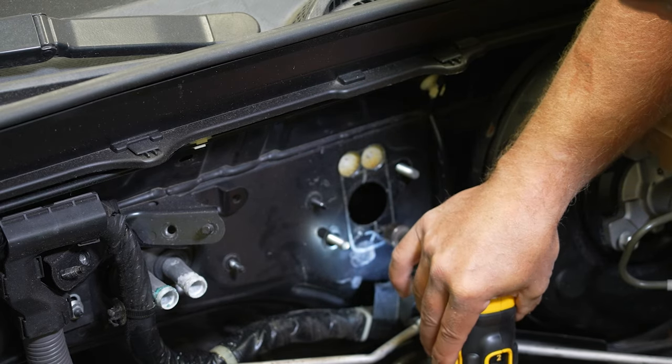And then we're gonna seat it. Simple as that. So the roll pin's all the way down in there. This fitting will no longer come out. The O-ring's sealed in there, so this is ready for attaching our line. Before we do that though, I'm gonna move on to this other fitting that's provided in the SIKKY kit.